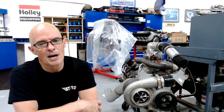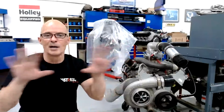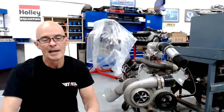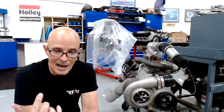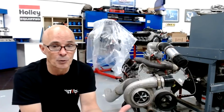I've done lots of testing with moving the throttle body to different spots. I have a manifold where we put 3 throttle bodies on it, opened 1 in the center, opened 2 on the outside, opened all of them. Once you get enough airflow, it didn't change anything in the power. I don't think we'll see a change in power on the NA motor from repositioning the throttle body, if it's big enough.